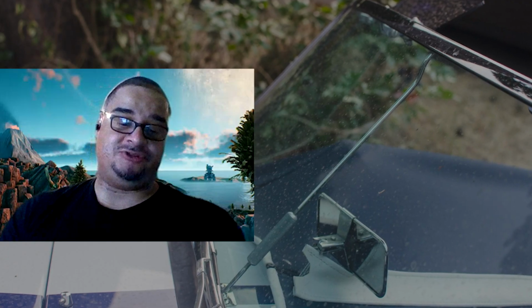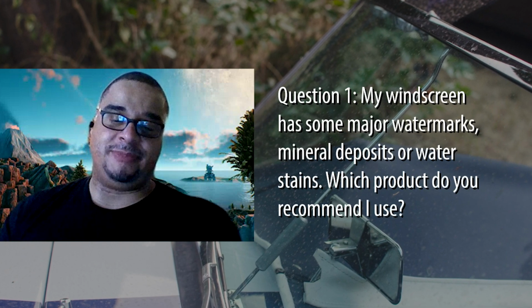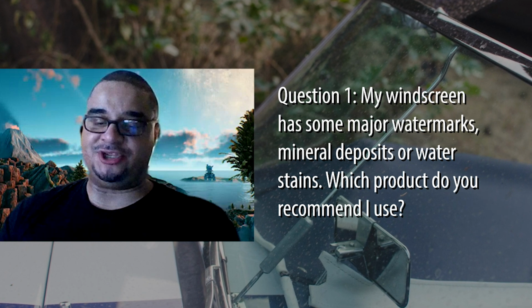Fred, why don't you start with some of these questions? Let's get going here. All right, Cool Breeze 0007 writes, "Hi, Dr. Turtle. My windscreen has some major watermarks, mineral deposits, or water stains. Which product do you recommend I use?" That's an easy one for me. Rule of thumb is go to Scratch, Repair, and Renew. It's got the highest level of our aluminum oxide platelets, and if you have defects on the glass, it'll take it off. So rule of thumb, that one is pretty safe to use on glass. I've used it all the time. You can use rubbing or polishing compound to help remove, but I find that they don't work as well as the Scratch, Repair, and Renew.